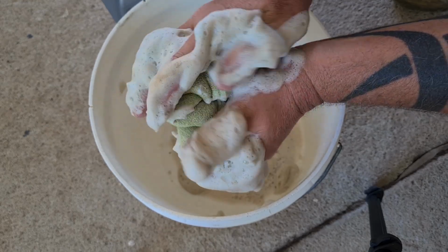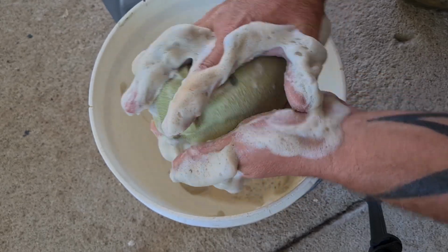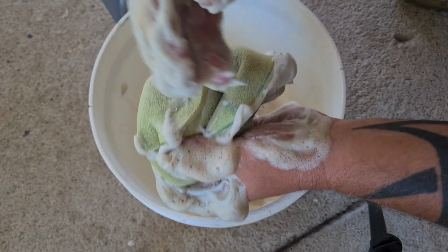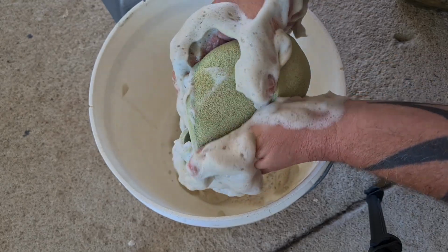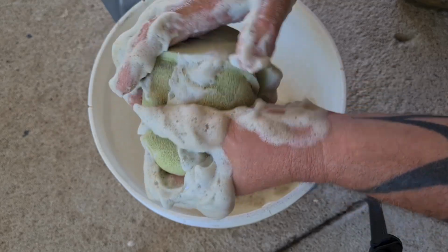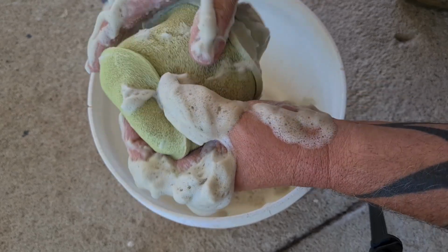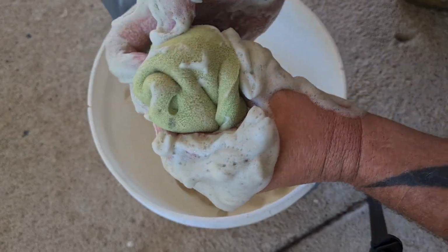When I first got onto this stuff, I was at a Theodore trail ride, and my air filter became so bloody choked up with dust and crap, and I needed to clean it. I went over to the Honda store that was there, and all they had was that Motorex air filter cleaner, and I had never used it before. I'd only ever used different cleaning products, and I was able to do this on the trail ride at my tent. I was able to just wash it out with water, dry it out and put it back in.